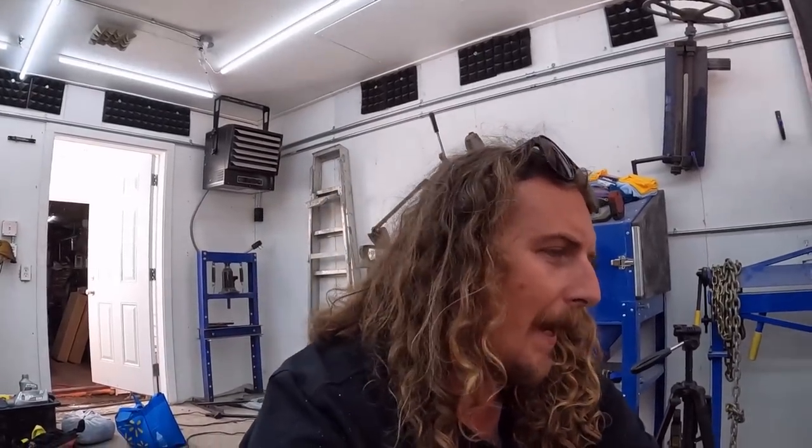Now, I consulted with Mike Cotton, expert painter and polisher, and he recommended, so I have this DeWalt dual action thing, he recommended just a hardcore polisher grinder style one and a wool pad after I wet sand, and it'll bring it back a lot faster. And a few of you guys have said that in the comments too. I guess these foam pads and the DA just don't put enough heat into the material, and I guess that's what it needs to work.